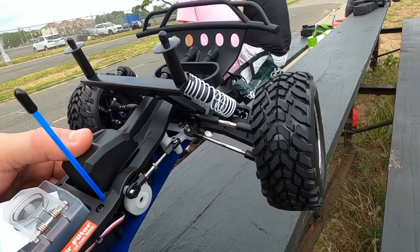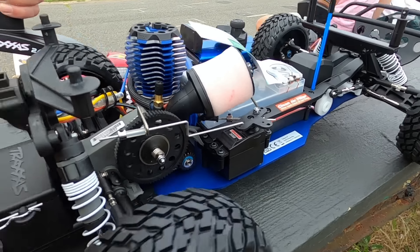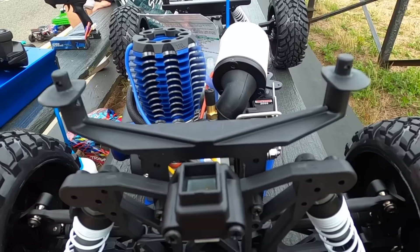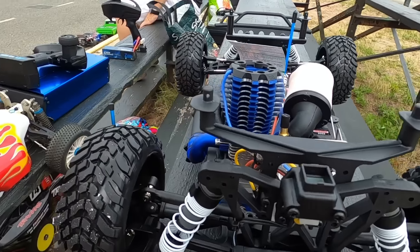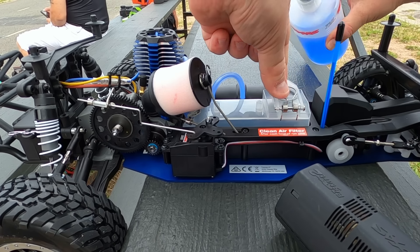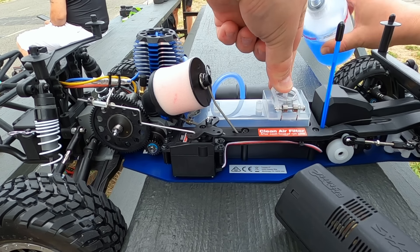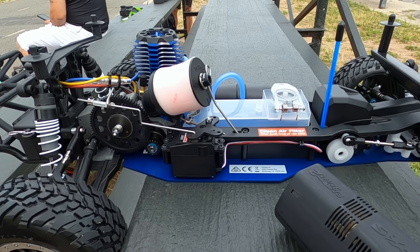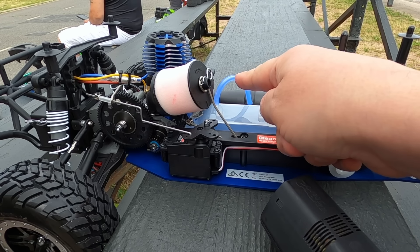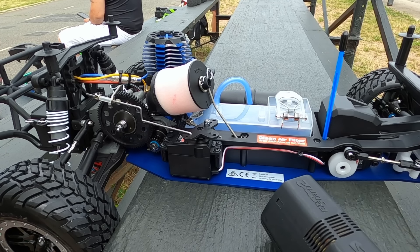Pretend you're driving a Mazda Miata. What about throttle brakes? Let's check out the servo on the throttle brakes. We have brakes — the wheels do actually lock up. The brake setup out of the factory is primo, just like a fresh cheese pizza pie out of a coal-fired brick oven. Make nitro great again. Let's put the fuel in there and we're going to proceed with the first heat cycle. You don't really need a full tank — I normally put in about three quarters of a tank. You can always add more fuel. There needs to be a little bit of an air barrier gap at the top because the exhaust line here is going to the pipe. You don't want it picking up a lot of fuel — you want it to have enough breathing capacity.